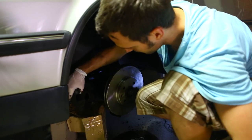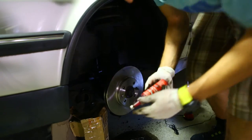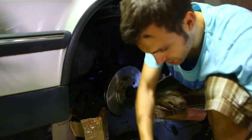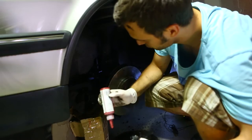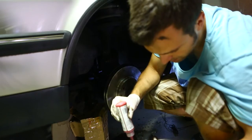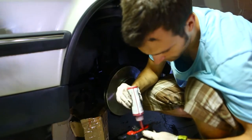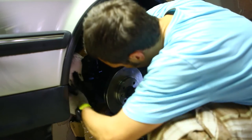What you can do is get a product — it should have copper grease, or various brands — it sort of helps you take your pad off easier next time. Also it stops the squeal. So what you do is apply a touch of this where the pad will touch the metal part. On the back part here — usually there's a plate that tells you where to go — just put a touch of this on the back and it stops any brake squeal.